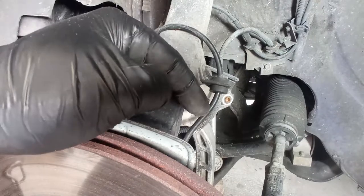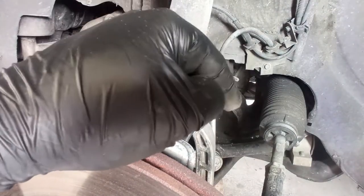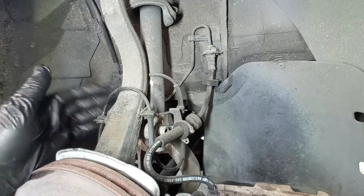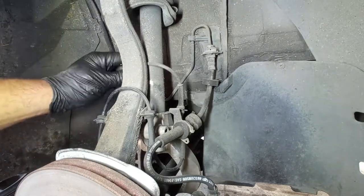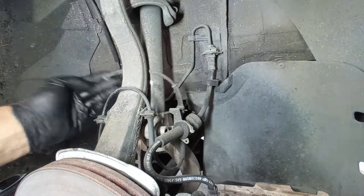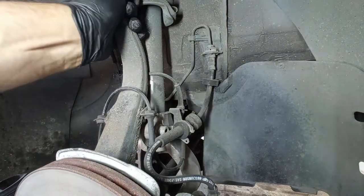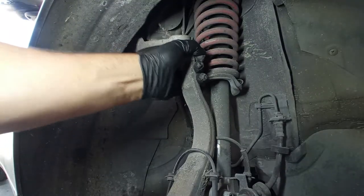On the lower ones over here and on the sway bar, let's see that later, because I will remove the subframe to do this job, and then I can see the place correctly. On this side over here, we have similar problems. This cable is not through here, it's from behind, okay? This one is not through here, it's from behind also, and because of that, it is not connected over there, and it is rubbing here on the shock absorber. We also have play over here, very noticeable, it makes noise.